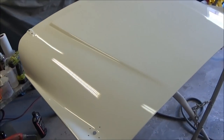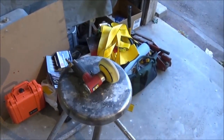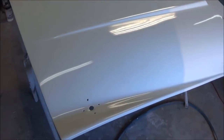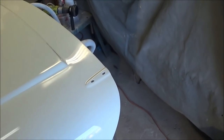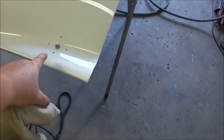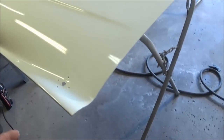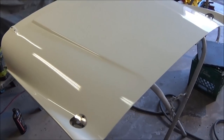That's been a couple of hours spent buffing the bonnet and I think it looks pretty good. In the tighter areas I used a small pneumatic buffer, which doesn't work as well as the full-size buffer, so we tried to touch those up as best we could — using the big buffer wherever it could reach. Next up, we're going to put the pin caps for the hood pins back in, polish those up, and get it ready to go back on the car tomorrow.